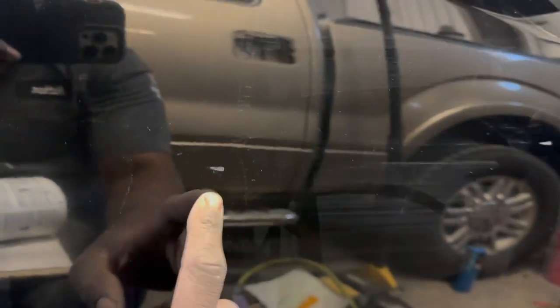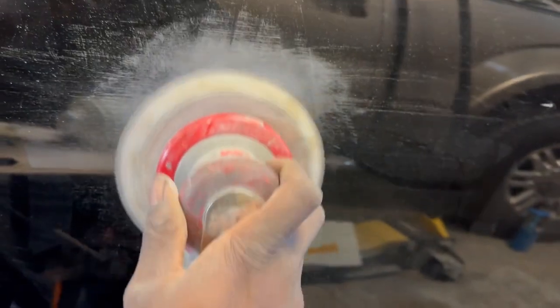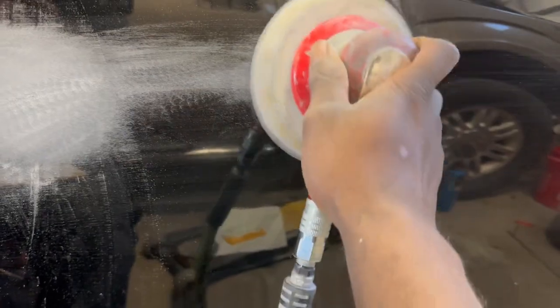It don't take no time at all, and I don't have to guess if the bodywork is good or not. I can't feel where that little rock peck was. Now I'm going to show you some more on the side door here. I'm just pointing out where all the little rock pecks are. Use the 320 just to find where the rock pecks are at a lot easier — just 320, that's all you need. Then 320 as well to help the putty stick to it.